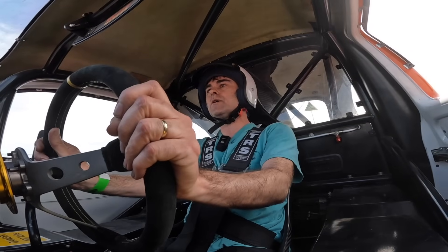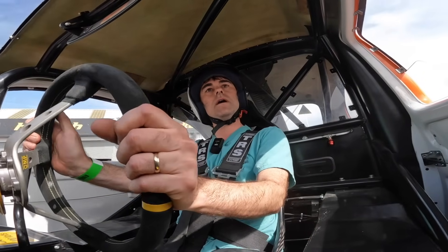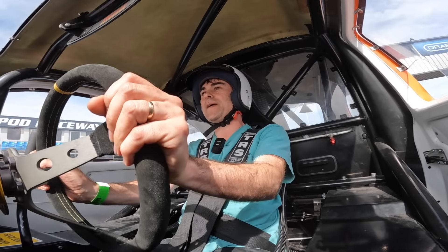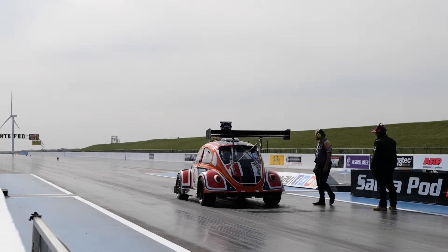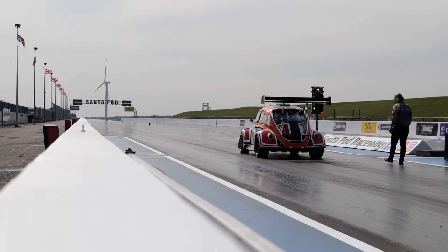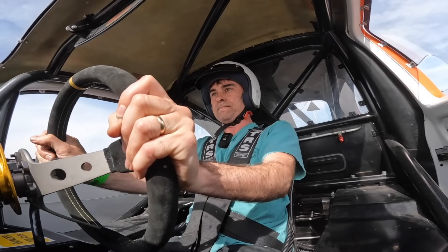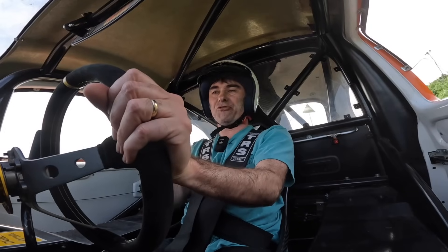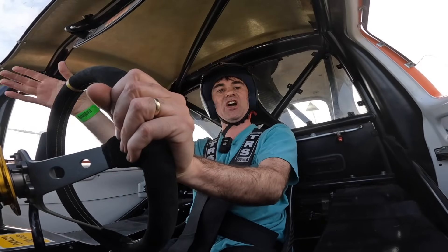Okay, we are away — aim of the game here, not to break it. I'm going to do a rolling start, get the car moving and then go to full throttle. So here we go, back at Santa Pod again. That was not good — we just had something like feathering back the throttle there. The controller wasn't happy at all. I was full throttle and it was just sluggish, so we'll have to have a look at the logs.